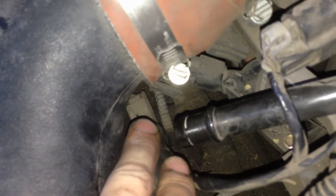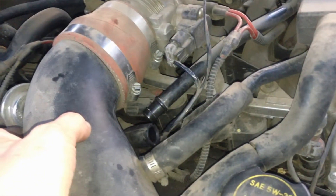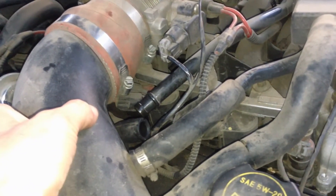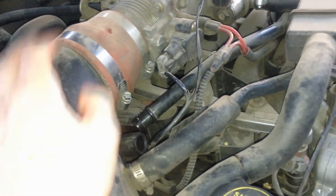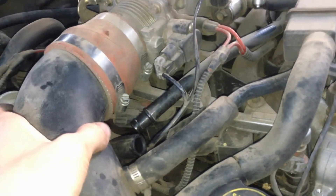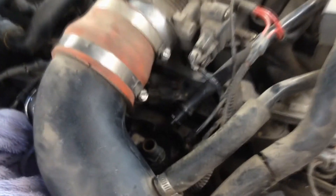These valves are very inexpensive, though this one has the electrical inlet which increases the price, and we went OEM — Ford Motorcraft. The problem with aftermarket PCV valves is they're not calibrated correctly for this specific model. Because we're buying official Ford, it's calibrated to our specifications — for example, how it ventilates air according to engine pressure when you accelerate and decelerate.